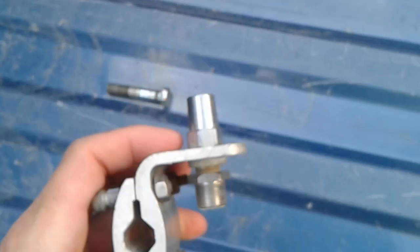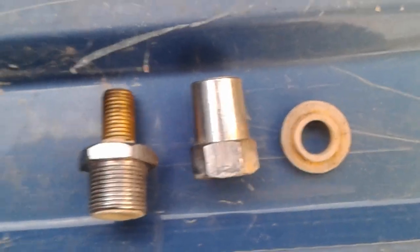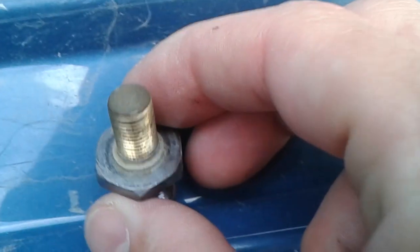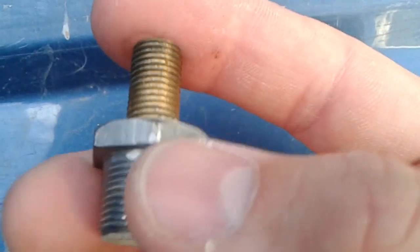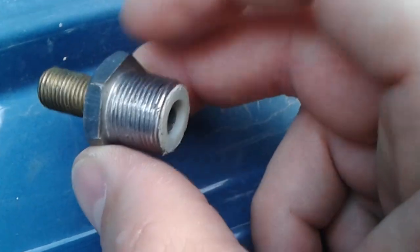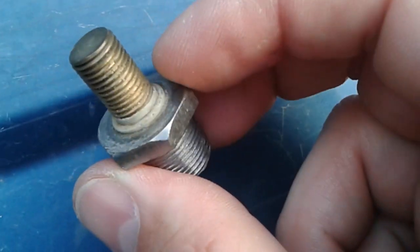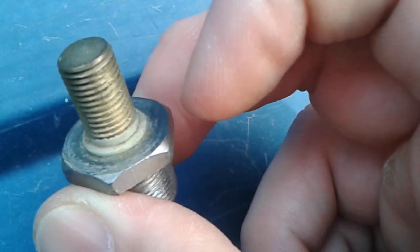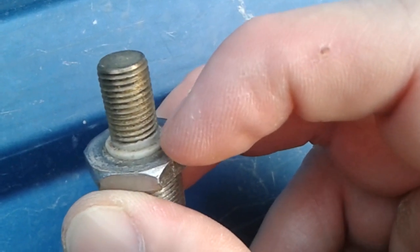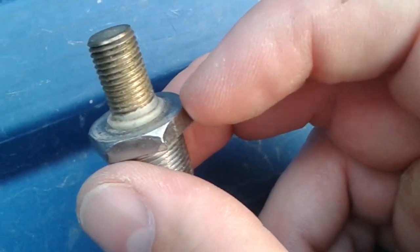Let me take this apart real quick. Okay so your pieces look like this. The center conductor goes into the hole in the middle, and the shield goes to the outside when you screw on your coax. This adapter has a built-in end insulator right here, so this part goes to the metal part of your truck. The center part is insulated from this outer part — they need to stay separate.